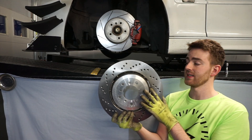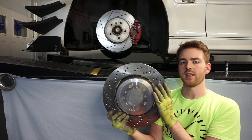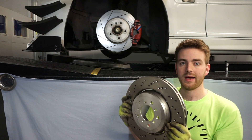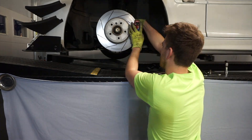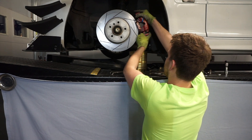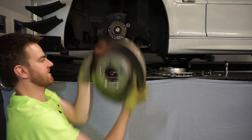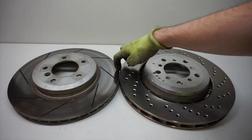The rotors going on the car are from an M3 CSL. There are actually only two ways to get this rotor: this is the BMW OEM one, which is drilled, and the ECS Tuning one is a drilled and slotted rotor. The ECS Tuning one is a little more expensive than this OEM BMW one, so I just went with this one. The rotor that's currently up there is a Geomet slotted rotor — links to both rotors will be in the description. Here are the rotors side by side, and you can see this one is quite a bit thicker.